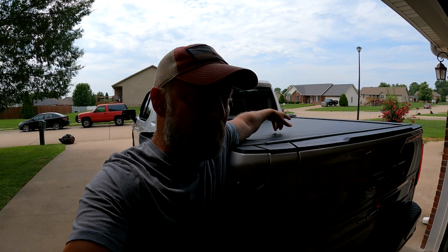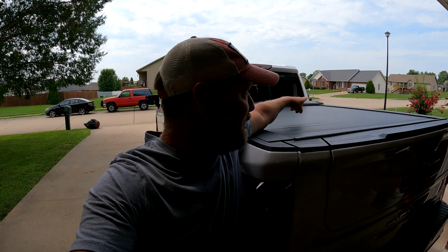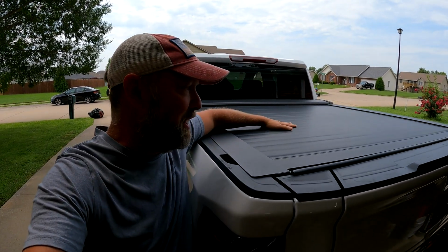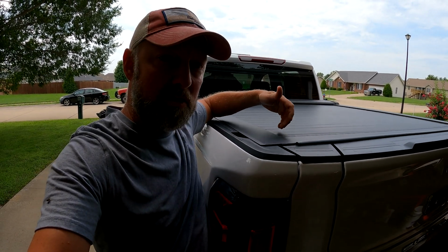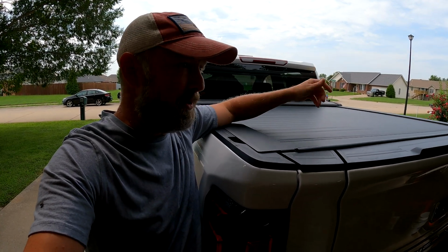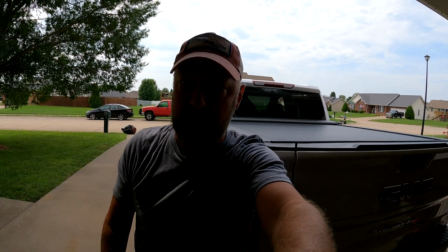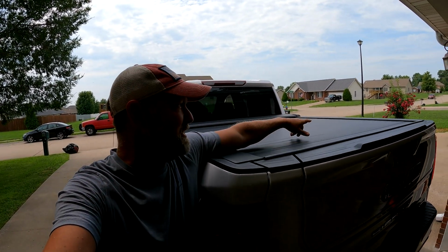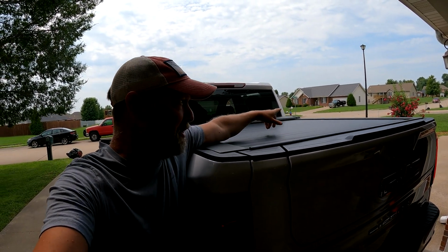So I took the cap off the main canister up there at the top towards the front, and I realized that on the right hand side, the edges of the metal, it's like aluminum that's covered by this fabric, but the edges are exposed, the metal along the side, and on that side it started to rub. So when it curls up in a roll, it started to rub over on that side. I was trying to troubleshoot exactly why it was doing that, and it didn't really make sense that lubricating the tracks would stop it, because it's rubbing up at the front.